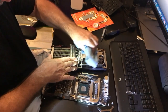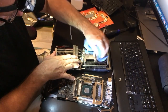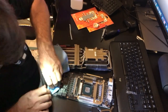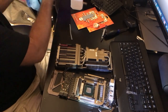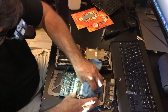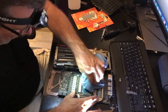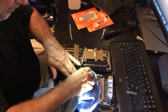There's the gunk - this makes a mess, so rub rub rub like there's no tomorrow. It comes right off with lots of rubbing alcohol. Turn your rag over so you don't smear it into the fins of the heat sink. Microfiber lint-free rags are perfect for this - you don't want tissue leaving any residue. Getting the main chip cleaned up. Keep the board clean - you don't want thermal paste getting into the fins of the heat sink.